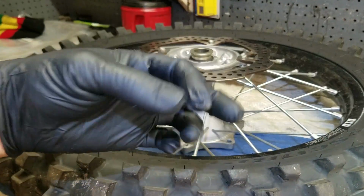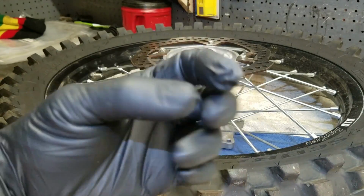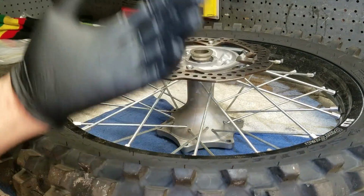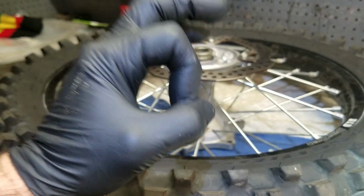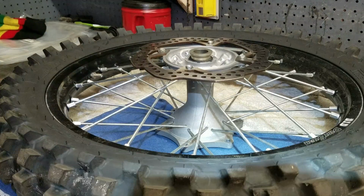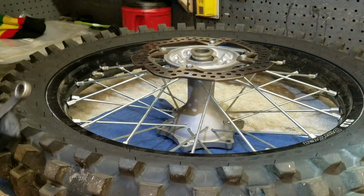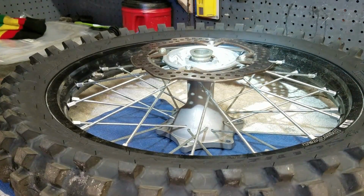It's on the shaft spinning underneath it. I guess it sits so tight on the shaft when it's brand new, the bearing for it is so tight, and it just got too hot, not enough lubrication, everything like that. It ended up melting that gear onto the shaft and locking up the bike's rear wheel. So my brother bought the bike off of him for about half the cost of a new bike, and opened the motor, and found that gear was literally welded onto the shaft.